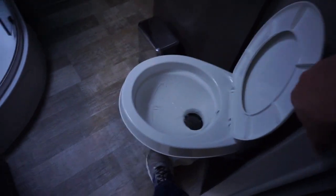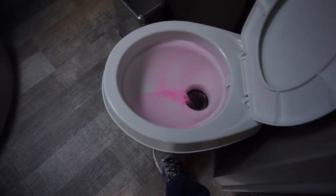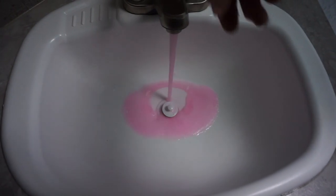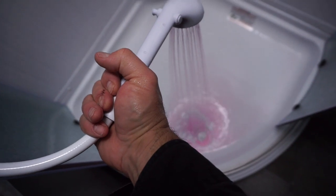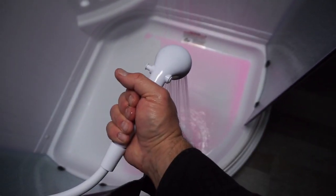Pardon the camera work here — I'm doing it by myself. Waiting for pink to come into the bathroom toilet — and that looks pretty good. We've got a new jug of antifreeze installed. We've got good color coming on both sides in the bathroom. Shower — okay, looks like we've got good color there. I just really don't love the reverse dials in the shower but I'm sure there's a reason for it. We've got good color in the bathroom. We're going to do the outside shower next.